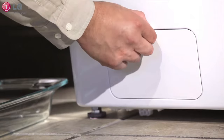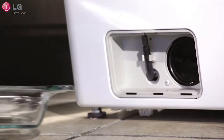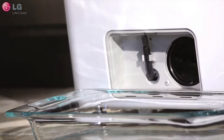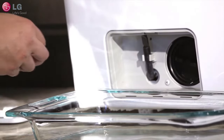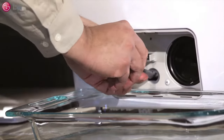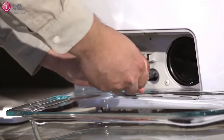Open and remove the access panel by pulling a tab downward and out, revealing a drain hose and drain pump filter. Pull the drain hose carefully into the pan and remove the plug from the hose, allowing the water to drain completely. Be careful not to pull the hose too far out as this can cause the hose to kink, preventing the water from draining properly.